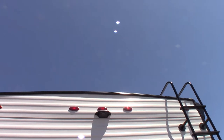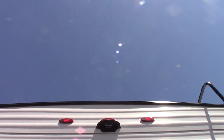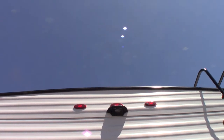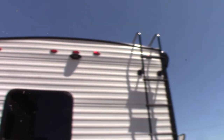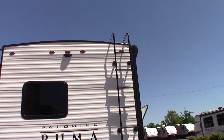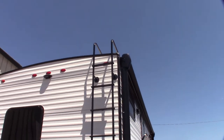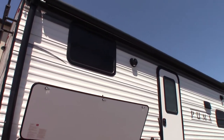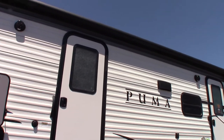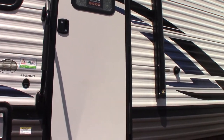This has campground cable and satellite through right here. This one is pre-wired for a backup camera — if you want to add one, get the same kind that fits that housing, which is a Furion. You've got a ladder, which is great because manufacturers state you should inspect your roof every 90 days. Go up there and look around carefully — make sure there's no cracking or separation at the sealant where water could get through, and check for any damage to roofing attachments or material from low branches or road debris. You're just protecting your investment and staying ahead of things.